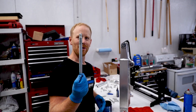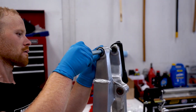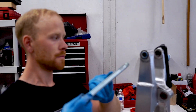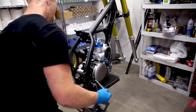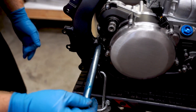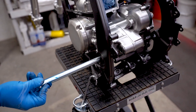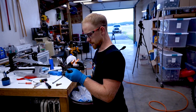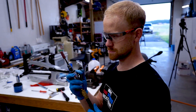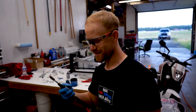The bolt wouldn't go in, so I tested the swingarm - it's fine. I thought it was the zinc being too thick on here but it was actually just the powder coat on the frame. So when you guys are powder coating a frame, you want to keep an eye out for that. Both sides are tight, we're gonna have to file that powder coat down.